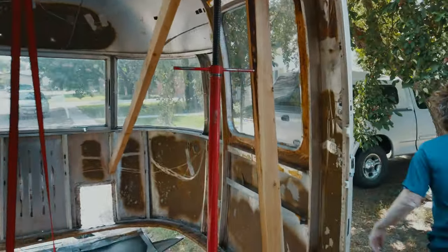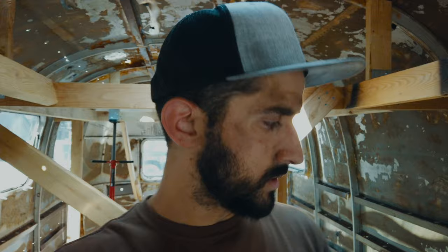Thanks for watching — that is how you lift an Airstream shell. At least that's one way to do it without building a whole gantry. Obviously if you can get the trailer in a shop and use a winch on the ceiling, do it that way — but I've got the trailer stuck in the front yard so this is how I had to do it. It was pretty simple: build out the frame, get the pole jacks, lift it up, anchor it down, and get some stabilizers on it. I want to give a shoutout to Ian over at Miller Garage — he's the only one I've seen who's actually done it this way and I copied him, so thank you Ian.